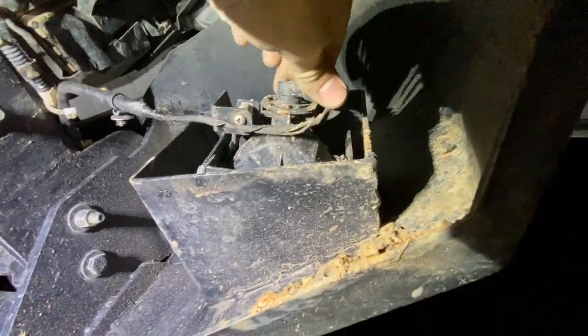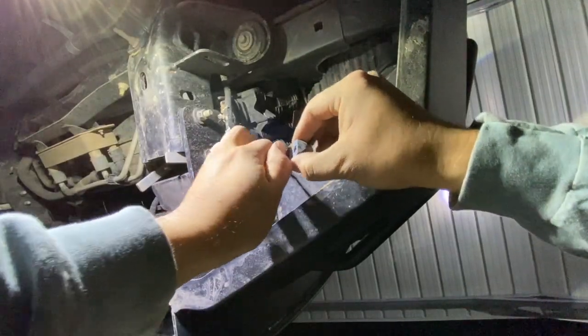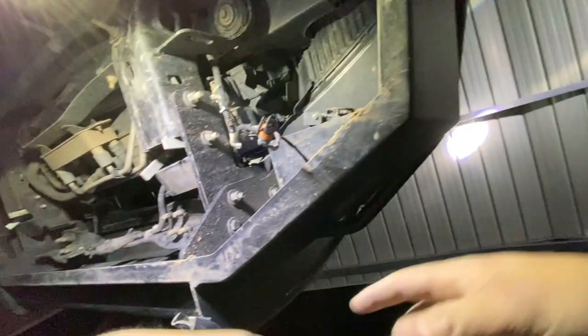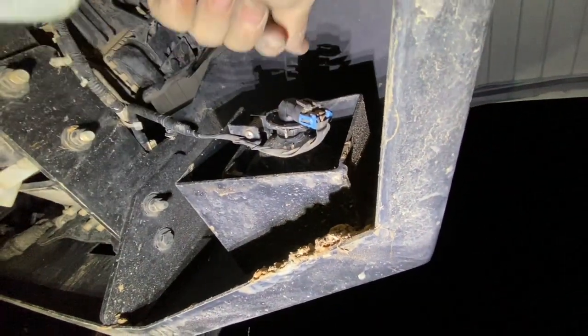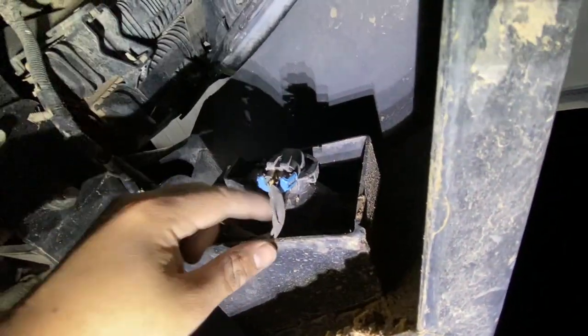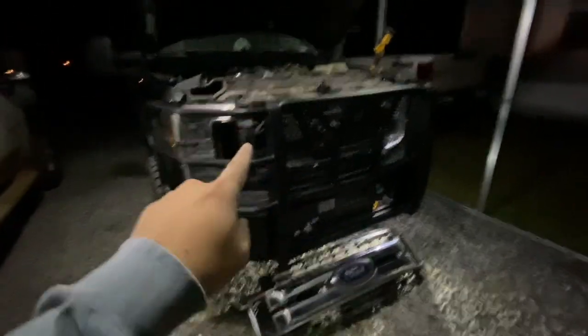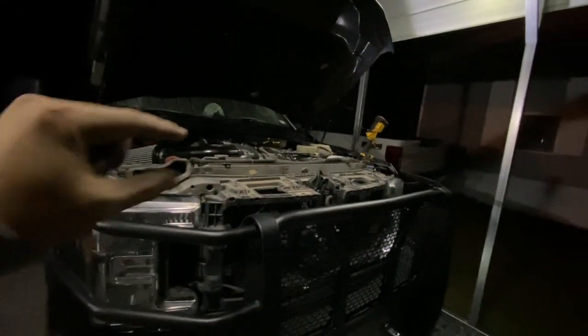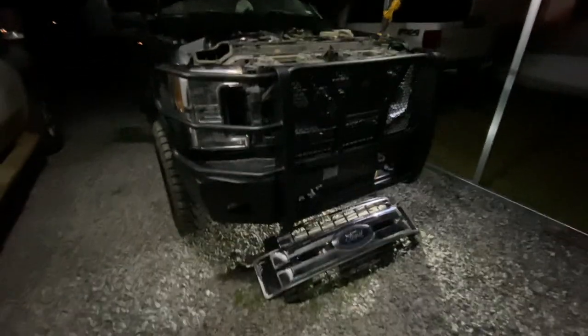For the fog light — he's got an aftermarket bumper so it's in a slightly different position, but normally they'll be right around this area. Same concept: counter-clockwise to remove, slip it out. Pull the clip out a little bit and pull it out, then take your new LED, slip it in, line up the holes, apply pressure, and turn clockwise until locked. After everything's installed, go back through the process in reverse — put the grill back in, all the 10mm bolts, and all the trim studs. Then you're ready to light her up. That's how you install these LEDs.